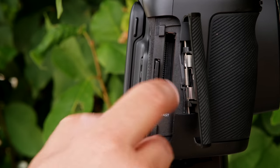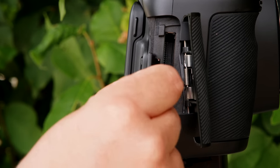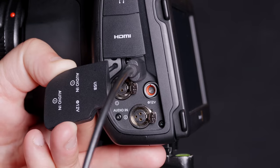In terms of the type of media you can use, this is actually a really flexible camera. You've got a standard SD card slot on this, also a CFast card — and I haven't used a camera with that in a long, long time. I know they're doing it just to keep it consistent with the rest of the Blackmagic cameras, but nothing uses CFast anymore. I would really like to see them move on to CFexpress Type A or B. But one thing I really like is that for long record times with affordable media, you can just plug an external hard drive into the USB-C port and it sees it as essentially a gigantic memory card — and you can even edit off that hard drive once you're done shooting.